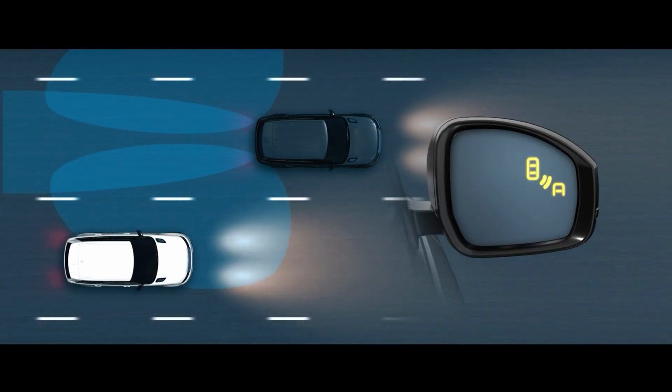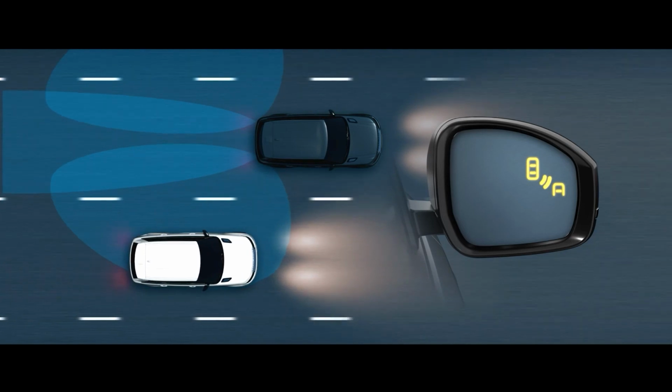Automatic braking systems for city driving are standard and detect other traffic, pedestrians and cyclists, preventing collision or mitigating damage. Cars fitted with adaptive cruise control have a high-speed emergency braking system. The lane keep system will provide a torque steer back into the lane if the car thinks you're drifting beyond the lane markers, so it's important to indicate when changing lane. If blind spot assist is fitted, the door mirrors incorporate a blind spot warning system, lighting up when a vehicle is travelling alongside and flashing rapidly to warn if a car is closing to overtake. If you start to move into the path of an adjacent vehicle, the car will deliver a torque steer in an attempt to avoid a collision.